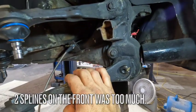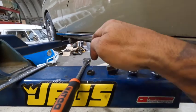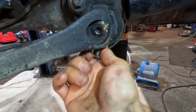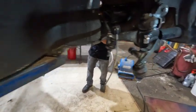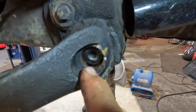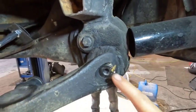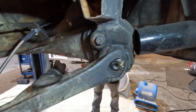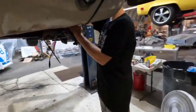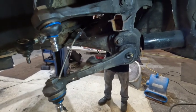Lowering a Type 3 in the front: if you're familiar with lowering the rear end using splines, you do the same thing on a Type 3 in the front. This set screw goes in the bottom - you only adjust the bottom arm. Once you remove the set screw, this arm can come out of the beam, and you can clock it up or down on those splines. You can see our initial mark and how we've moved it one spline. Initially we did two splines raising it for the two-inch drop spindles - that was too much of a raise - so now we're just going to take one spline away from it. Bottom adjustment only; the top one is just a floater.